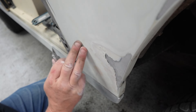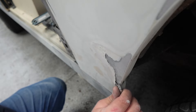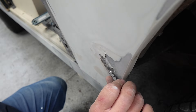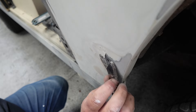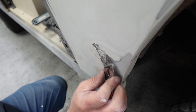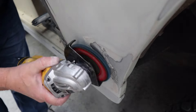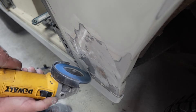I'm just basically trying to get this base paint off, but you can see it's feathering — look at that. That's what you're up against when you've got a lot of filler. It's just not worth hitting it with just a sanding disc. We're going to have to go in there with a flap disc, take that whole area back, and then see what we've got and work from there.